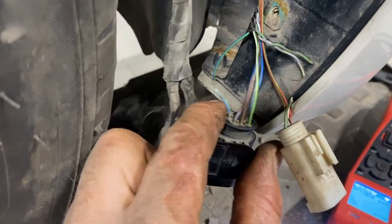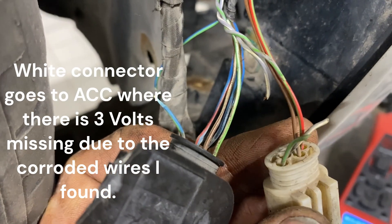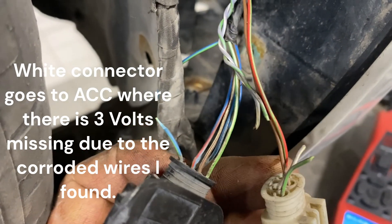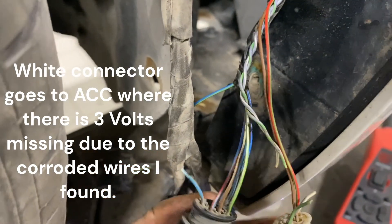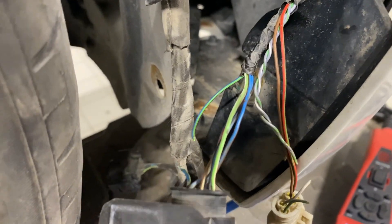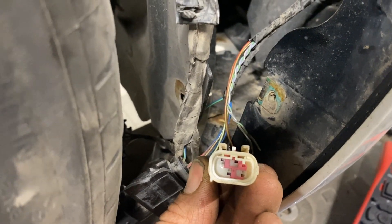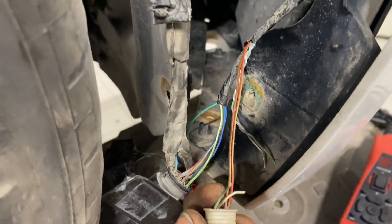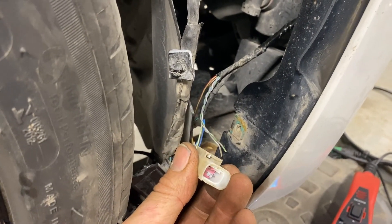From the ICM to this point is okay, and we don't need to go any further. I was going to show some elaborate testing but there's no need today. These two pins were completely corroded and rubbing away because this hasn't been connected to the car properly. I'll put some new pins in there — hopefully the wiring isn't black inside. This one here is hopefully the reason why one of the parking sensors doesn't work. This is the power supply, ground, and CAN — and this white one is dedicated to the ACC sensor.